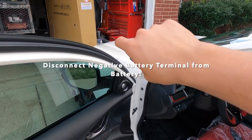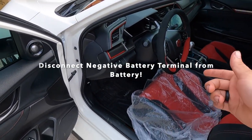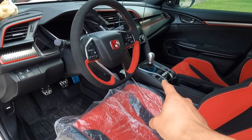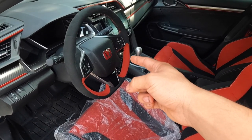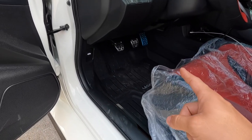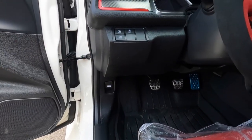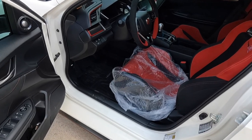Before anything, make sure you open up the hood and disconnect the negative battery terminal, because you're going to be messing with a harness that's going inside the car. For a quick overview: we're going to remove the centerpiece right here to get to the pad area, run the harness through, bring it under and over, and on this side is where the connector goes. Once we remove this panel you'll be able to see it better to connect the wireless charging pad in.